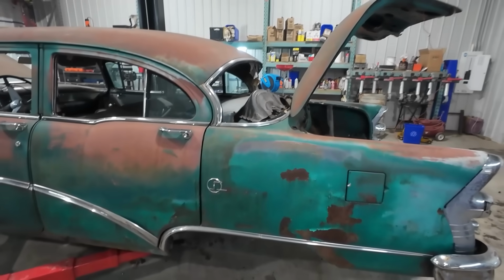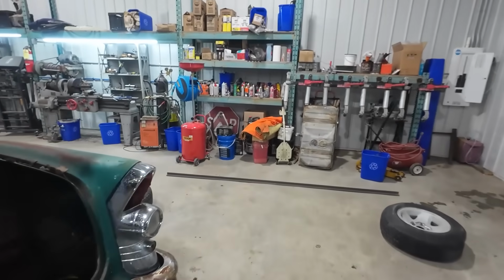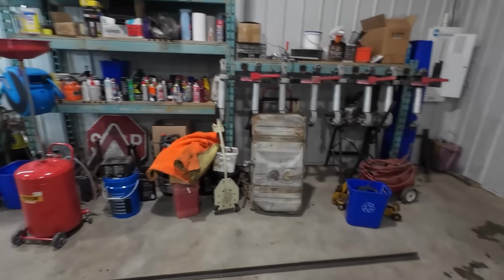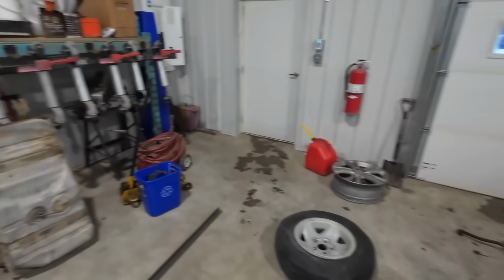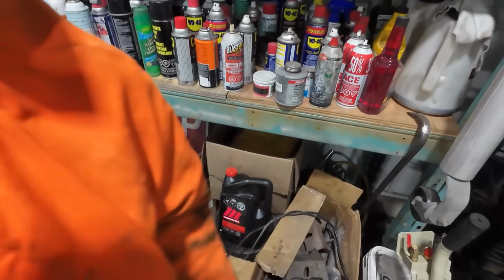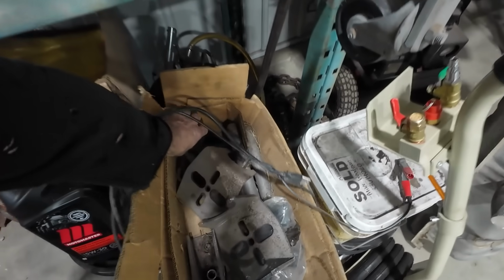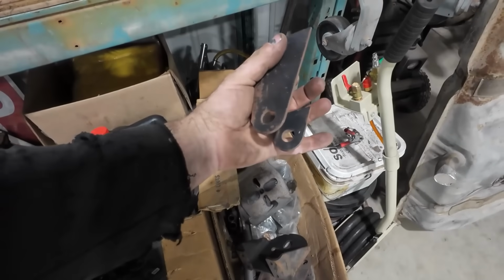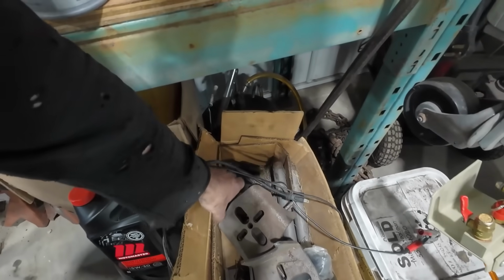And then hold the diff in place, and then we'll just see how the four bars, if I can just use them right out of the box, or what we gotta do. Should probably get the forklift over here, because he's gonna have to do some cleanup on top. We have to grind and clean. We might mock up, figure out where we gotta clean the diff up first. But we'll see where these bars go, and if it has a couple universal mounts, and if some of this stuff will just work, or we're gonna start cutting stuff on the table.